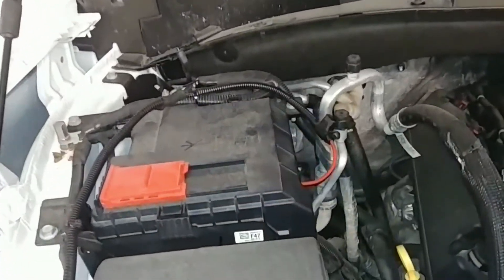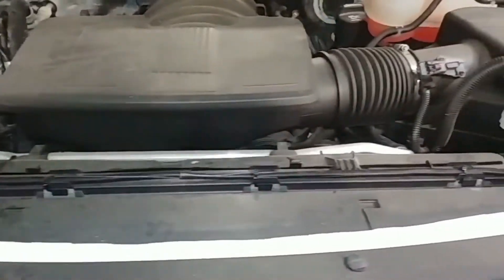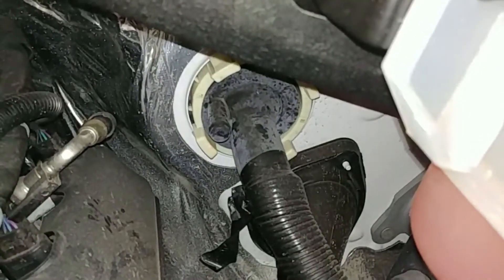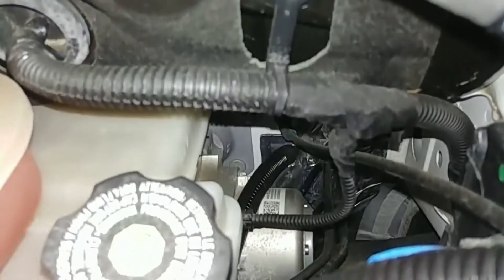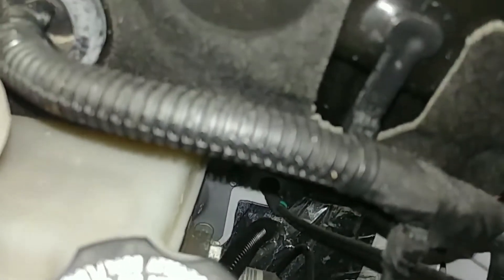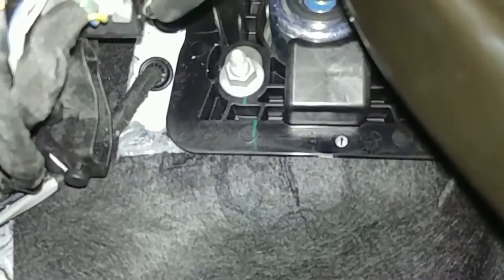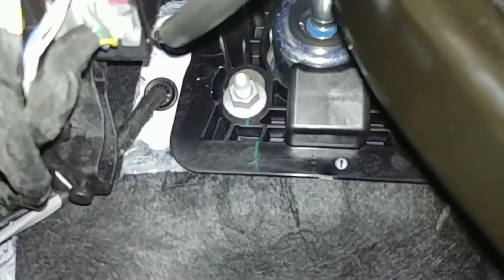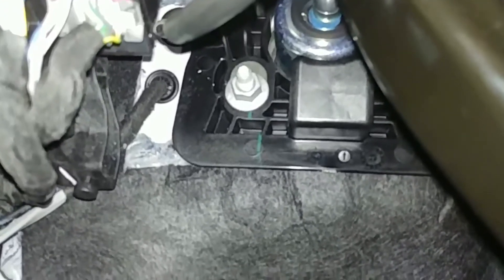There's our power and our fuse tap right there. We ran it around and then straight across, running everything through a hole in the firewall. In this particular one I went ahead and drilled a hole — you can either run through the factory boot nipple on the left by cutting it open, but because we had quite a few wires, we drilled right in a spot just below the cable coming out above it. We'll include a three-quarter grommet, and that's where we've removed some of the carpet and drilled the hole with a three-quarter unibit — wiring comes through really nicely right there. A great access point we use quite often on these Chevrolets.